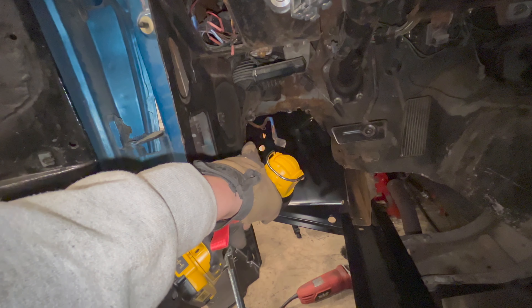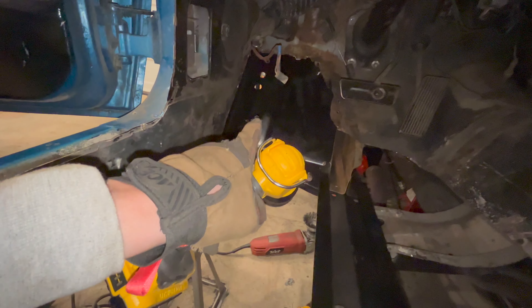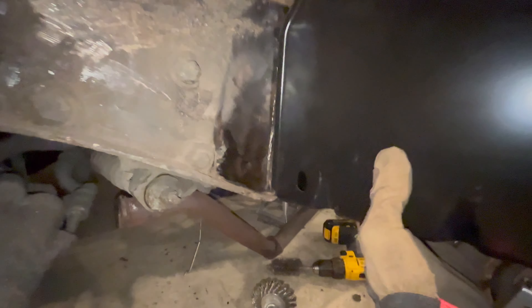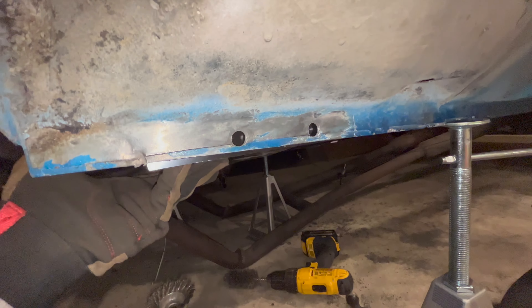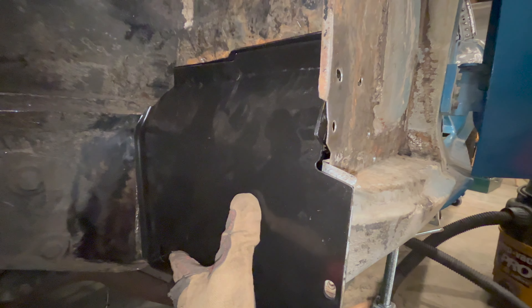There's a slight gap, but that's actually going to pull in nicely. Lines up with the spot weld holes that I drilled from the other side. Couldn't be happier. And test fitting the lower rocker — if I hold it up in place, you can see it lines up just about with where the old one was. The flange hits nicely there. I can't do this single-handedly, but the upper part pulls in, so that should work nicely. And to anyone who's ever installed a one-piece torque box, teach me your wizarding ways.